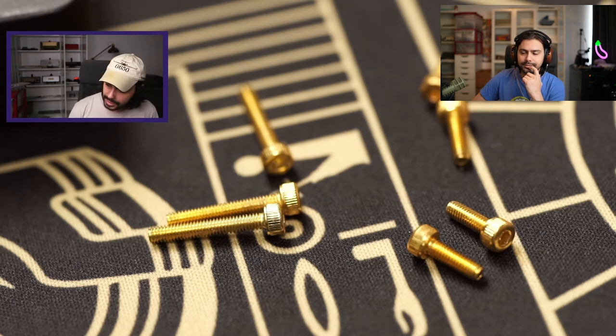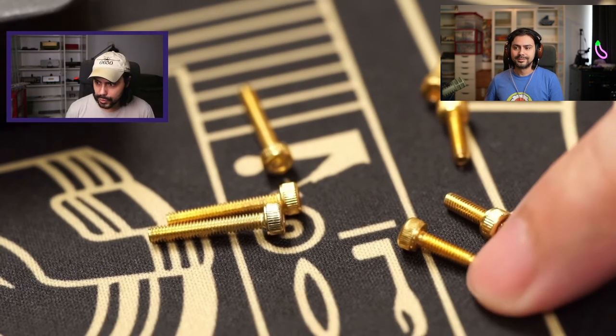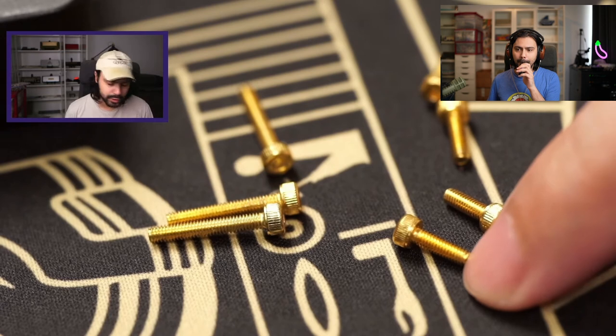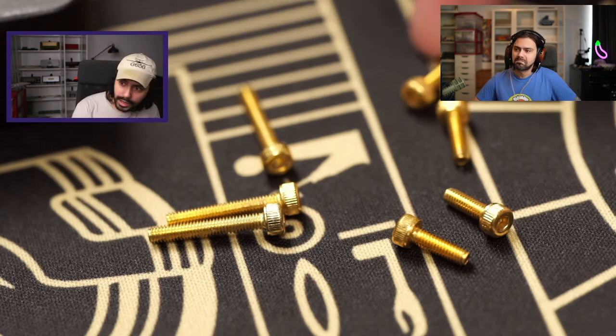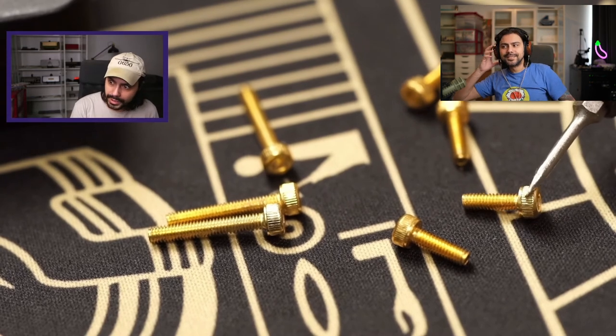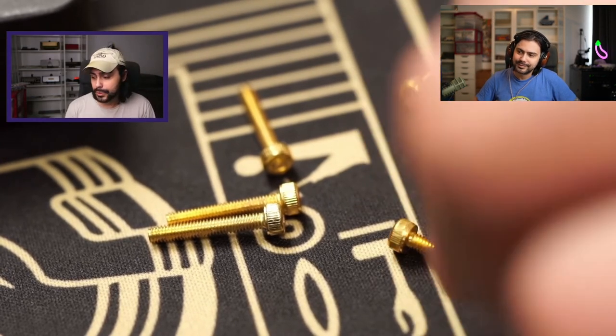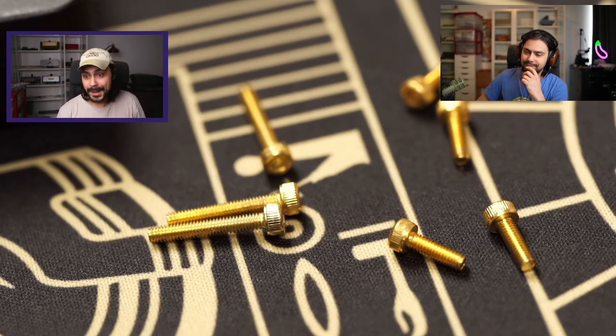These screws are gold color plated. What I'm looking for is black residue from the screw tap process at the tips of the screws — and they're incredibly clean. This means not only are the screws brand new, but the screw taps of the keyboard have been cleaned during the quality control process. These screws are actually knurled — you've got little ribbing where you can grab onto it with your fingers. This is not at all necessary for a keyboard and actually might be detrimental more than beneficial, but I really like it.